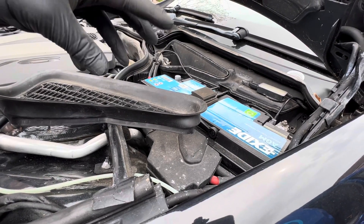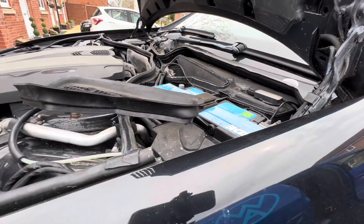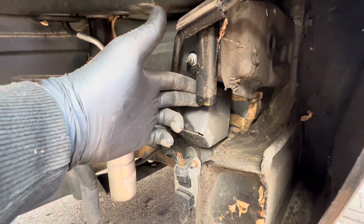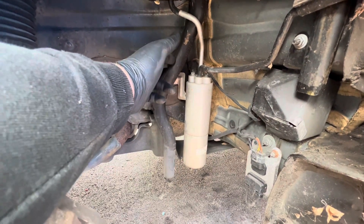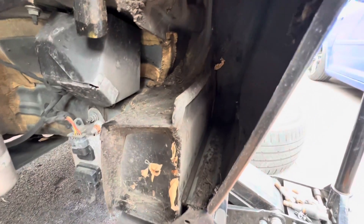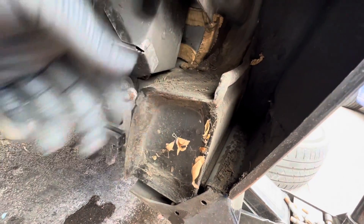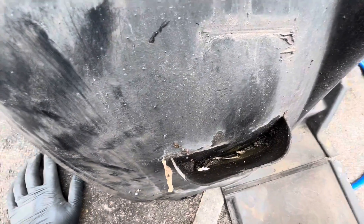Over time it slowly seeps down behind the bulkhead, into the carpets and the underlay and insulation, which suck it up like a sponge and hold it there. This generally only happens with stormwater, but it will sit in that tray if it can't drain out. This is where the main drain tube goes into the back of the wheel arch liner, so we'll check that. We've also got another longer tube — that's for the bonnet, where the bonnet drains into the scuttle panel. I've also cleared out in here because it was full of muck and mud. Let's concentrate on these.